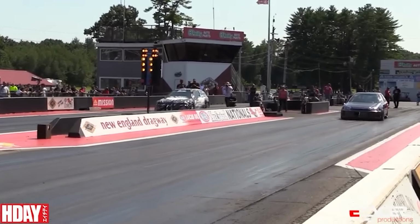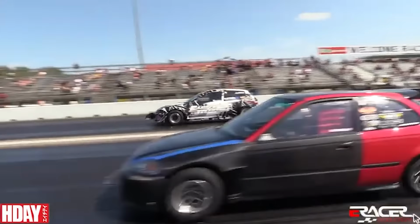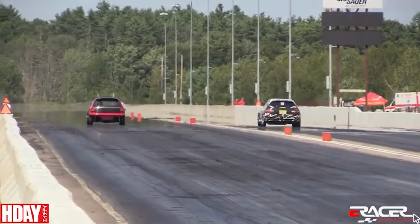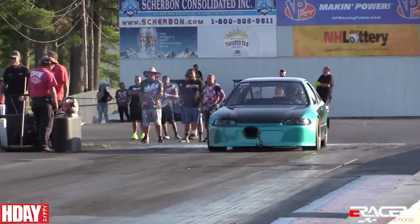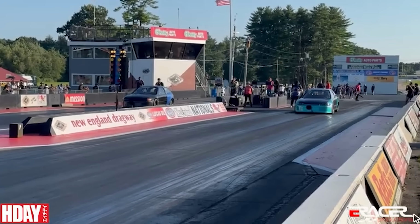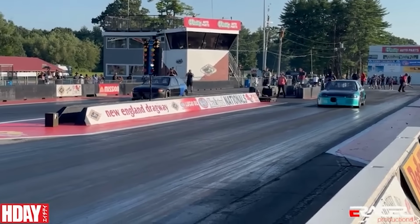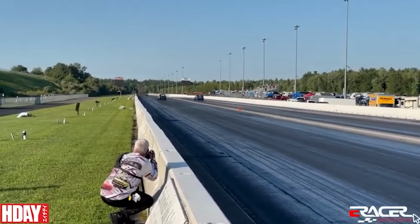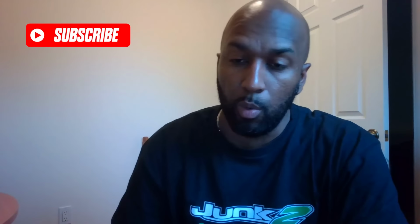It's funny because in All Motor, for the last 10 years, they've had all sorts of restrictions in their system, and so they're optimizing with those restrictions. The engines are like, we can do anything to them, they're just not responsive because they're choked. We tested a header last night. Dave and I have been going back and forth with this, well, really me, a 4-2-1 versus a 4-1. I had a 4-2-1 header designed for the program a while back, and it's what we've been using because we tested it right before I made a head change to Dave's head. And going to the 4-2-1 picked up power.